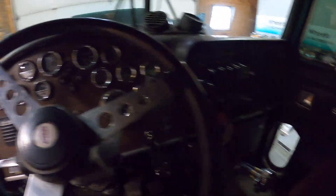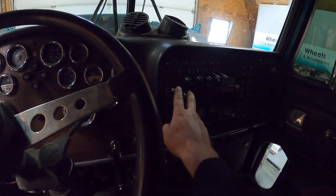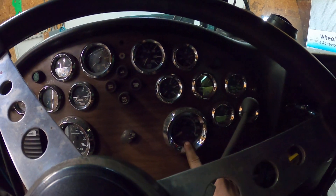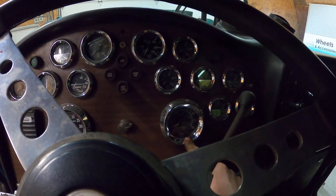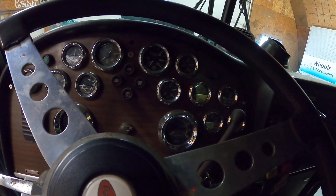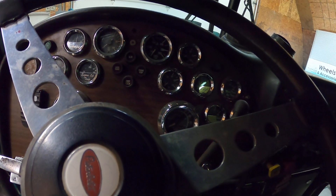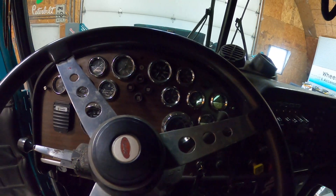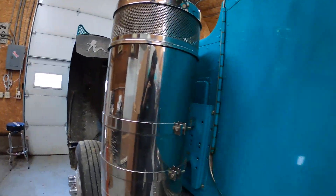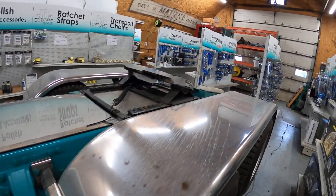It's an electronically driving truck. The only thing it does not have yet is cruise control — the switches are wired for it. It does high idle. We're having some problems with a speed signal. This is what I believe to be the original speedometer head with accurate mileage at 893,000 miles, and we're trying to save that. We've bought a couple of pulse generators but haven't yet found something that will reliably produce a pulse signal for the ECM to maintain cruise control.